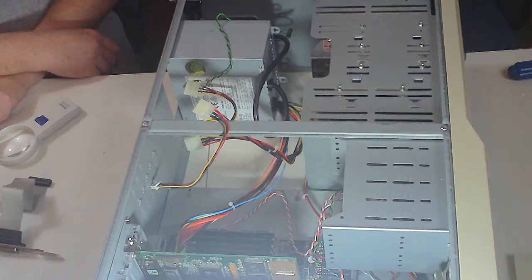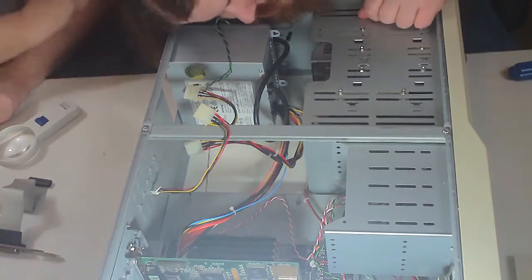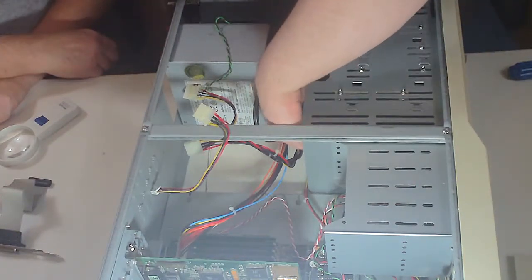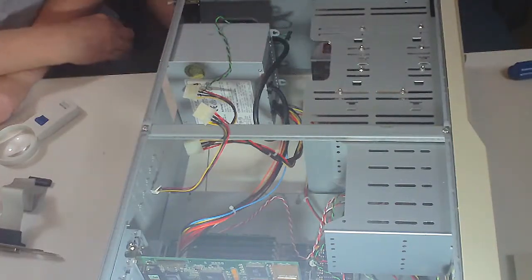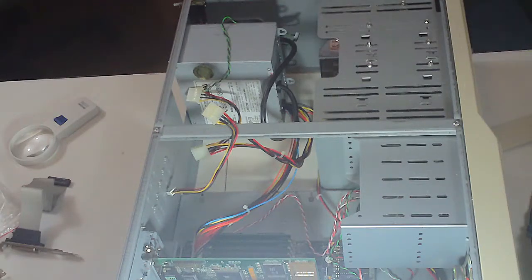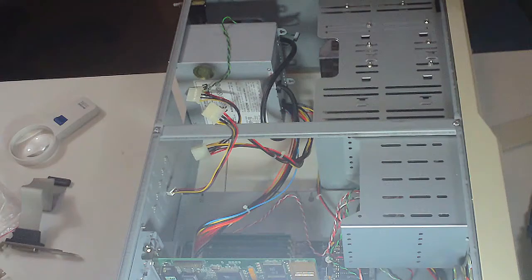No, that would be a flop for a floppy. And we're gonna have to run 2 data cables or move the hard drive up to the top slot so it can hit both the CD-ROM and the hard drive on one cable. I would recommend always screwing them in part of the way until you get all of it properly aligned. That's what I always do. I'm sure it's standard procedure for a lot of people that build this kind of crap.